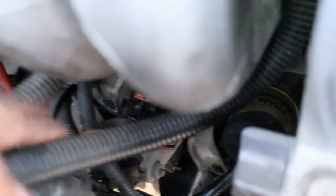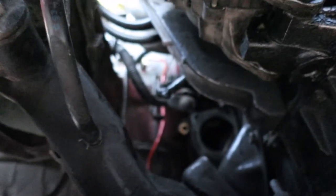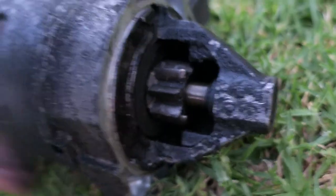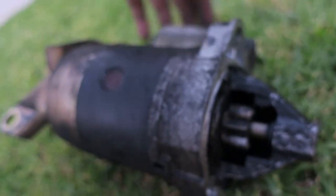With our 14mm socket on a 3-inch extension with an adapter and the breaker bar, I got that bolt off - it just fell off, the bracket collapsed, and the starter fell out. I slid the starter out right through the hole - and here she is. We have to take out the bracket because we're gonna reuse it. So much gunk on it. Looking at the gears again - this tested to be a good starter, but it is old, it was worn out, and it was leaving me stranded.